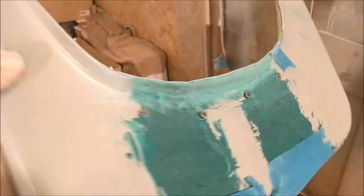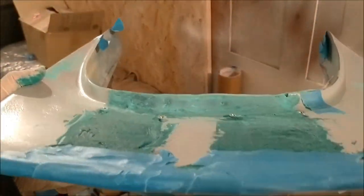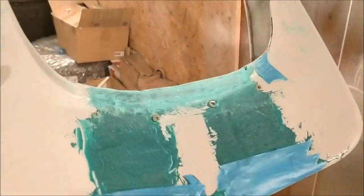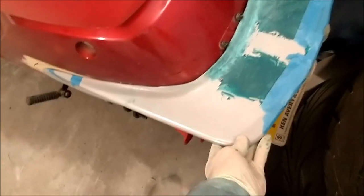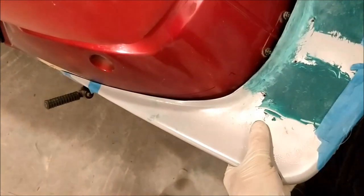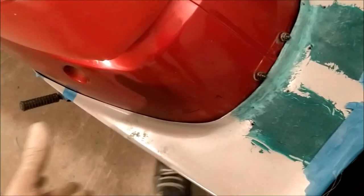After a little bit of bridging filler in the gap to smooth it off, I've sanded the top part — it already looks like it's one piece. Not going to take too much work to get it all flat and smooth. Now it's just making up some more fiberglass and resin and doing the lower half. With no wooden supports at all, that's actually being held together by the fiberglass. It's all one piece without any stabilization — doing pretty well. Test fit — it slips on pretty nice. Going to redrill the holes.